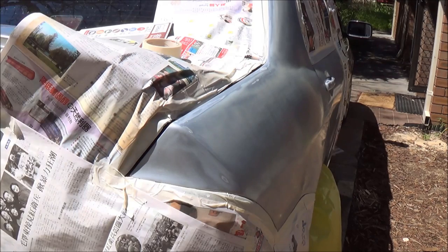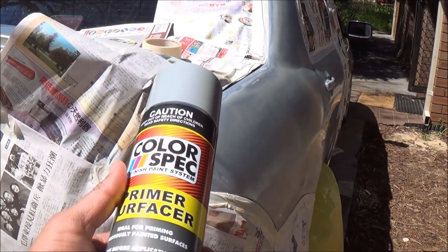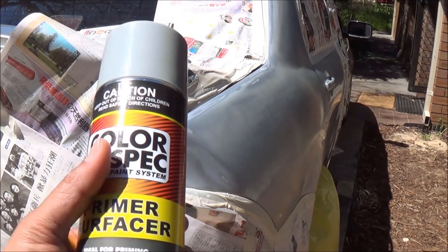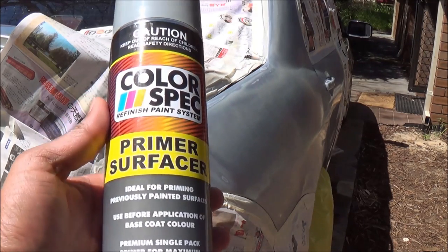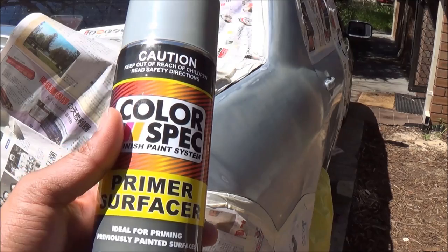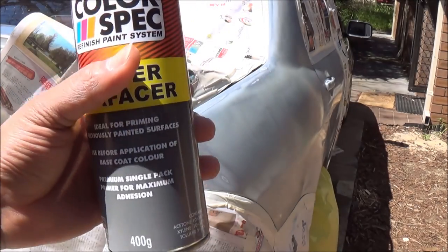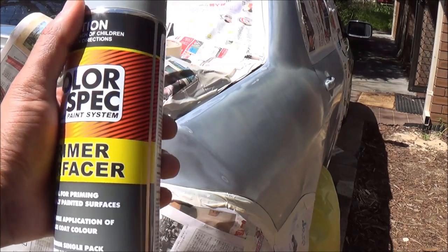And also, when you're using these spray cans, it's a good idea to wash the can with some hot water, so that'll help increase the pressure inside. It's just a little physics, so you'll get a bit more paint out of the can when the paint level inside is going really low, and it will also help give you a good spray pattern.